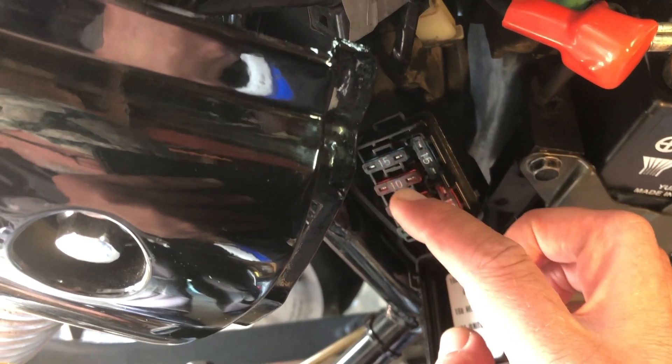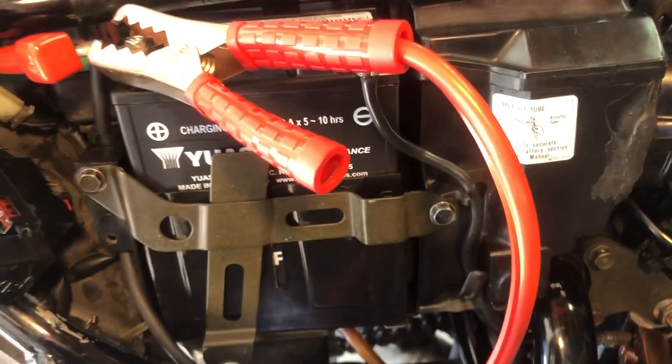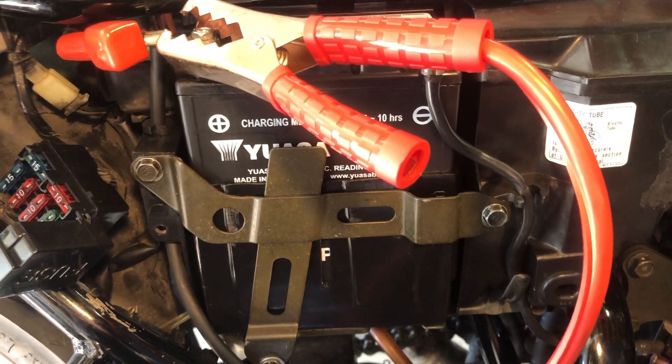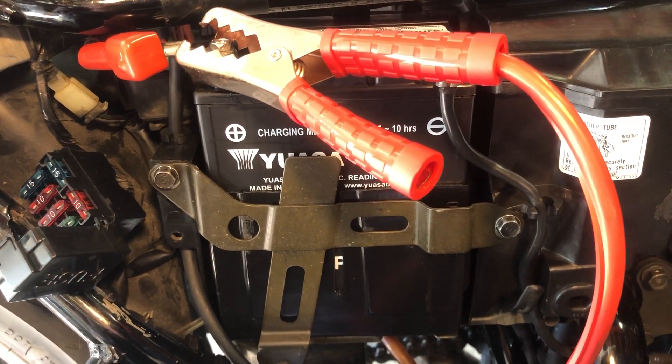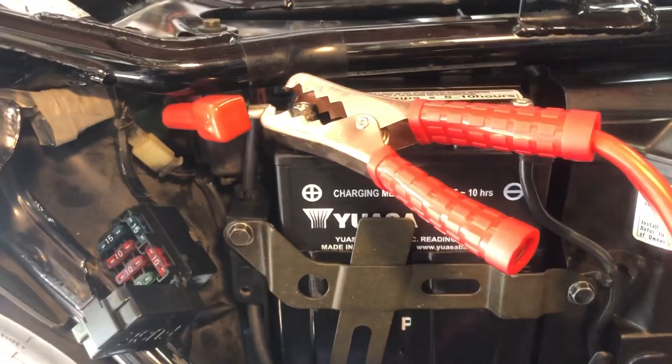It's helpful to remove the taillight and the headlight fuses — it makes things easier on the battery. Also, because the motorcycle battery doesn't have much capacity, I generally hook it up in parallel to a car battery, and so it's pretty easy installation.